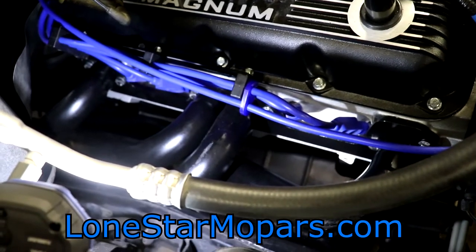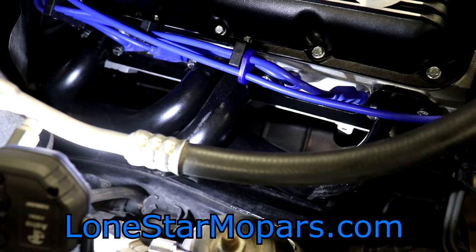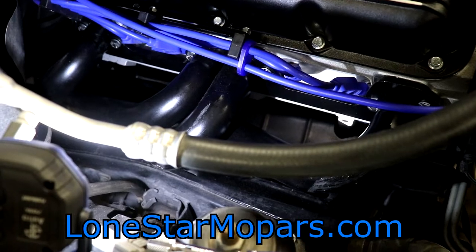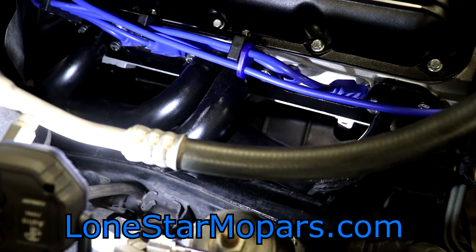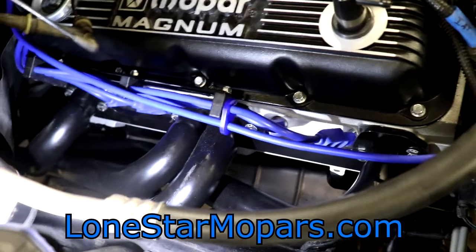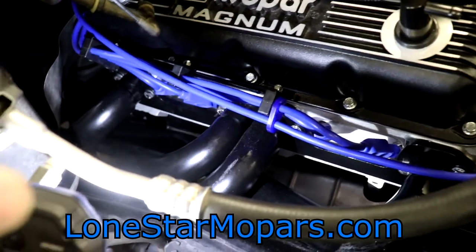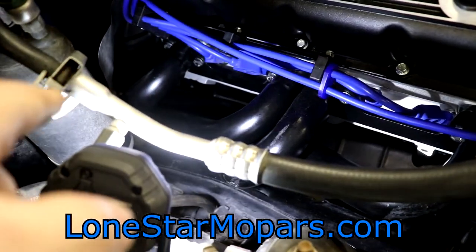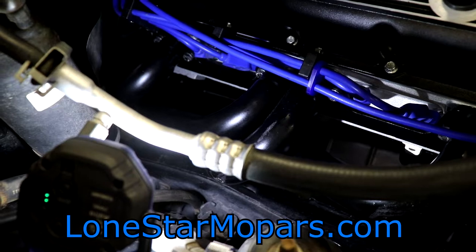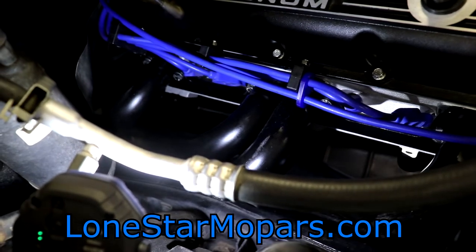That wasn't too terribly long — maybe 15-20 minutes and we've got the shorty out. There it is, obviously black painted. We have the long tube Pacesetter and then the silver ceramic coated Gibson. It sure would have been nice to have done this before we had everything reassembled. I'm going to go ahead and try to get the Pacesetter mocked up. It's probably going to be easier to come in from the bottom, at least over here. Hopefully you can see what's going on — that might be the world's fastest long tube install. I extracted the Gibson from the top and somehow wedged the passenger side in there. It sort of just fell into place, oil filter stayed on, everything checks out. All six bolts are in — it was effortless.